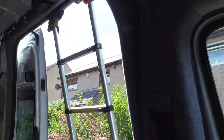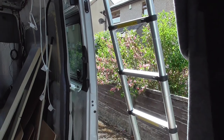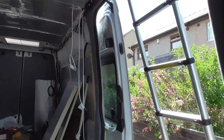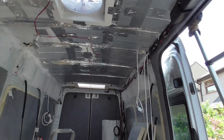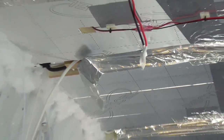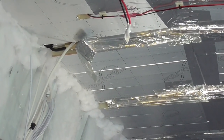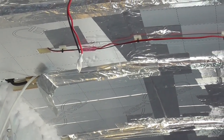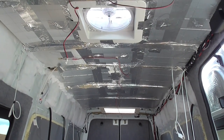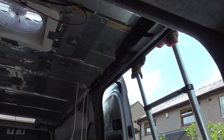We've done the trim around the door — we've got the door to do yet, but we'll have to do that together at the weekend; it's a big job to do alone. Then I need to get the ceiling tidied up with some aluminium tape that's started to come off. This is the 100mm stuff — it's difficult to work with. If you're going to buy aluminium tape, get the 75 or 50mm. I'll tidy all that up and start the bubble wrap from the front, working to the back, and get these wires tidied up as well.